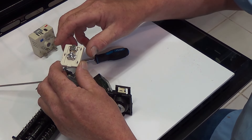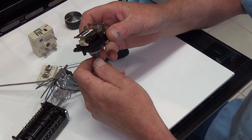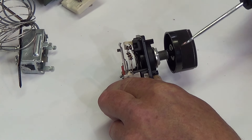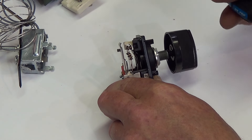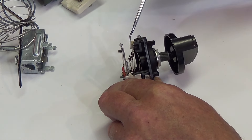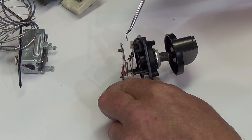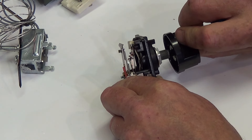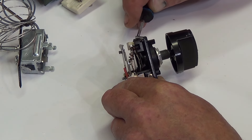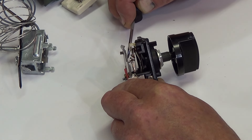With an energy regulator this isn't done mechanically — it's done with a bi-metal strip. In the off position the points are open. When you set the energy regulator to maximum temperature, the points are locked, meaning electricity flows to the element constantly and it glows red all the time. But if set to say 50%, the bi-metal strip at the back expands, straightens the arm out, and opens and shuts the points to cycle the element on and off.